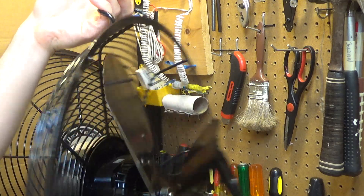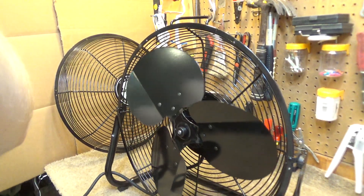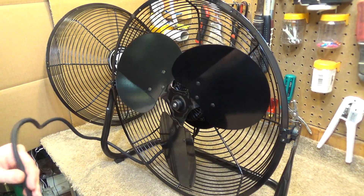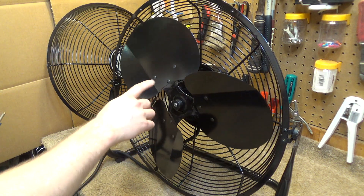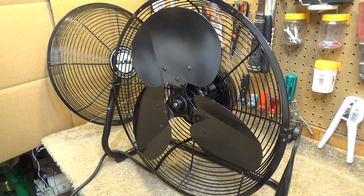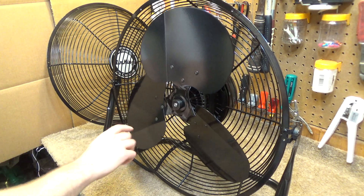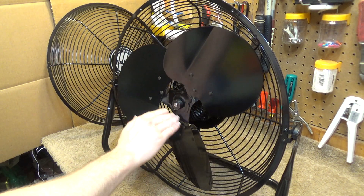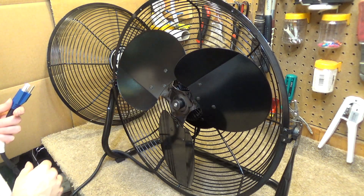Let's power it on and see if that made any difference. If that didn't make any difference, that's about all we can do. I'm not really concerned about it because, as I said in the other video, this is a ball bearing fan, and ball bearings are a lot more resilient to vibration than sleeve bearings are, so it's probably not going to cause a longevity issue. See, this is another thing right here - you can see it's spinning backwards. That means one of these blades is heavier than the others. I'm going to say it's this one. If I put it that way, it turns this way; if I put it like this, it's probably going to spin down. So this blade is a little bit heavier than the others. Looking at the way this is spinning, this side of the blade is the side that's a little further out from the shaft. I think it's an issue if this hole wasn't drilled exactly into the center of the blades. I'm noticing there's a little notch in the center there - I'm not sure what that's for.